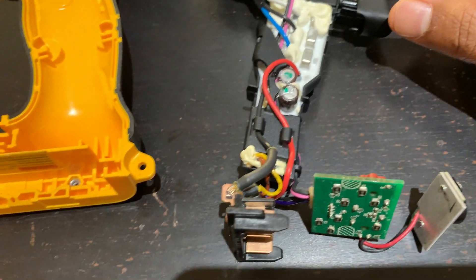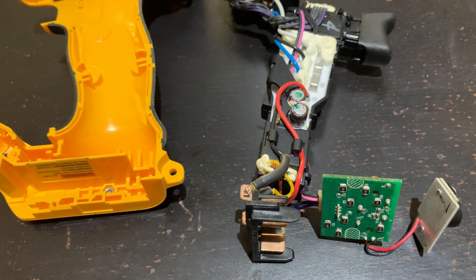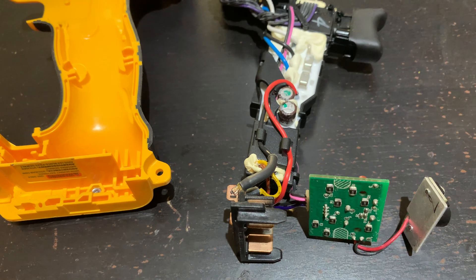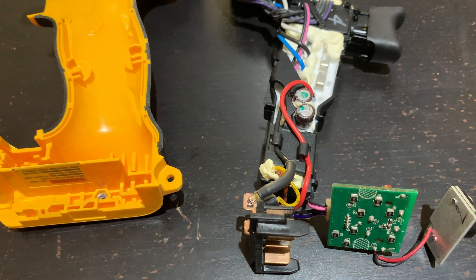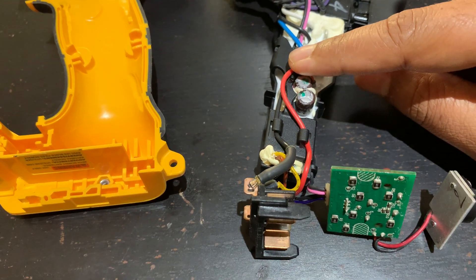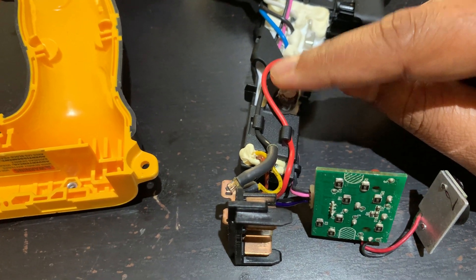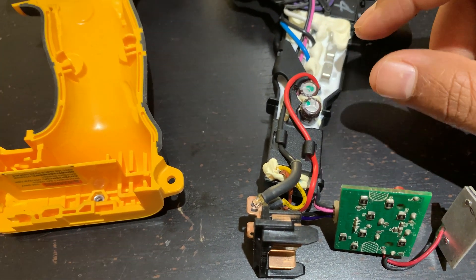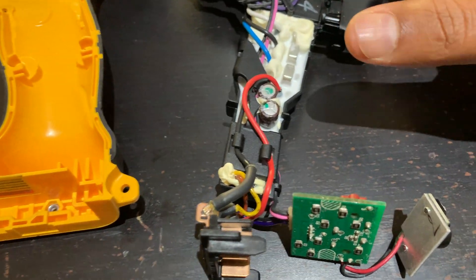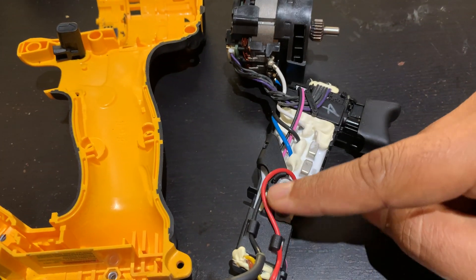What's important to note is that the battery that connects here is a lithium-ion battery, and the battery case itself doesn't have any electronics to stop power in case it goes low — that circuit is in here. If you look at the battery pack, you'll see there are five batteries connected in series providing about 21 volts directly to the terminal. There are no electronics in the battery pack itself that stop power to the drill — those electronics are in here.